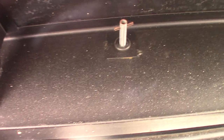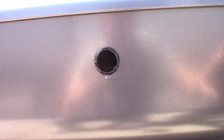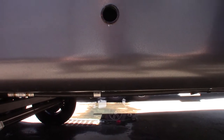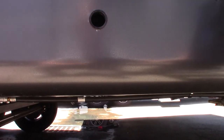There's also a means where you can crank the slide room out manually. There's a pin with a shaft right there — you can see it looking straight through that hole. If the slide room happens to fail for any reason, you can crank it in and out manually right there. It's going to take a lot of cranks, but it will go in and out. That's another good feature.